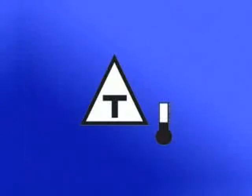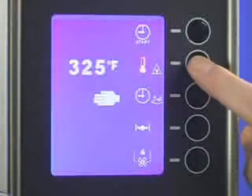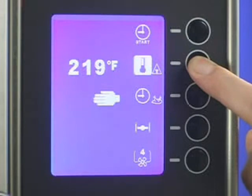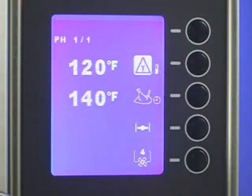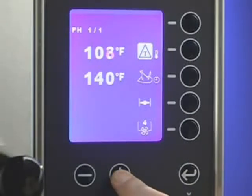Set all other cooking mode settings and press the start-stop button. By setting the probe using delta T, the oven temperature gradually increases as the internal temperature of the product increases, always maintaining the oven at a set number of degrees warmer than the product. Delta T can provide a slow cooking process that allows the product to reach the required internal temperature with maximum yield. To set delta T, press and hold the selection line button next to the temperature icon. The icon will change to the delta T icon and display the set temperature difference between the oven cavity and the core probe. Use the plus and minus buttons to adjust the delta T set point temperature.